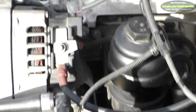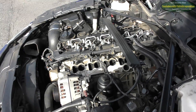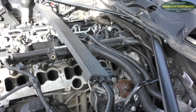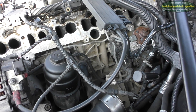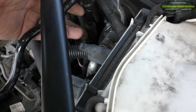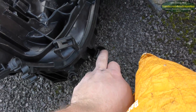The process of taking this manifold off - this is the 3 Series, 2010 version, N57 engine. First of all, there's plenty of cables on it. You've got to unplug them all - find all your cables, unplug. There's connectors which connect to this, so you've got to take them off. You've got these things here which you can just unclip - jam a screwdriver in it, pry it open and it'll open up. These take E-sockets, but we used a 5mm which worked perfectly. They sit in there really nice and snug because they're only going into plastic - not tight, so they come out really easy.